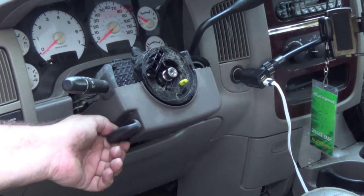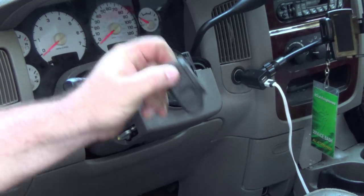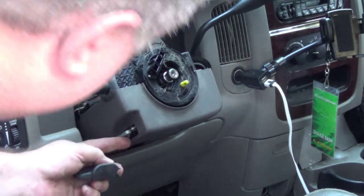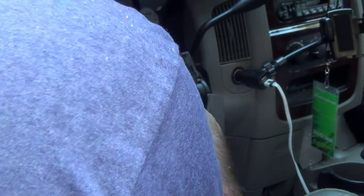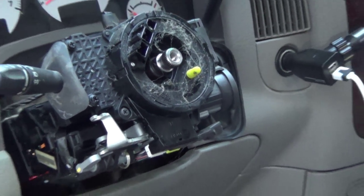The steering lever on this one doesn't have any kind of set screw — it just pulls off. I don't think any damage was done; I imagine you were supposed to push into the square hole to release it, but I got it off and it doesn't appear to be damaged. Bottom cover is gone and we now have fully exposed the clock spring.